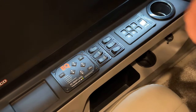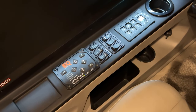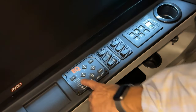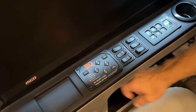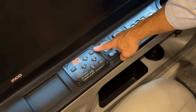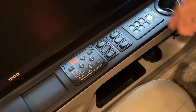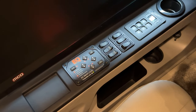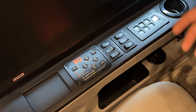When you're ready to level — slide rooms are out, you're on the air ride bags — you would turn the ignition on. With the ignition turned on, we turn our power button on, and the LED shows that our ignition is on to give the pump power. Once we click on auto level, it goes into operating mode, the pump runs, and the jacks are pushed down to the ground, then the coach comes up and auto levels.